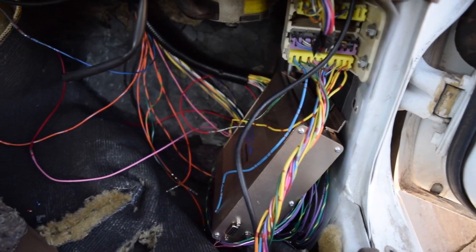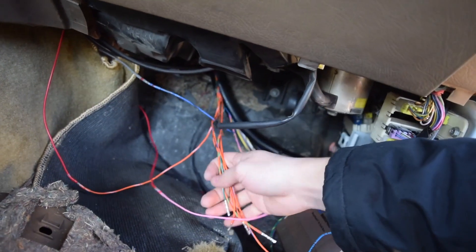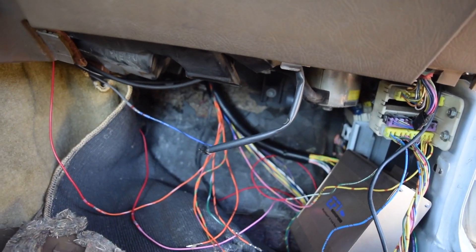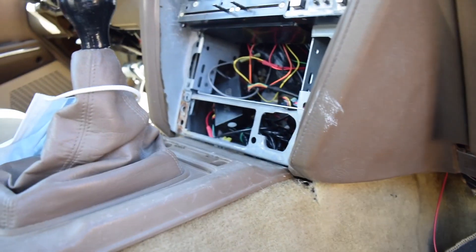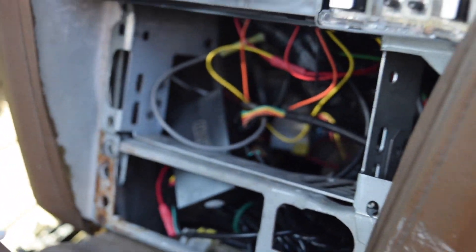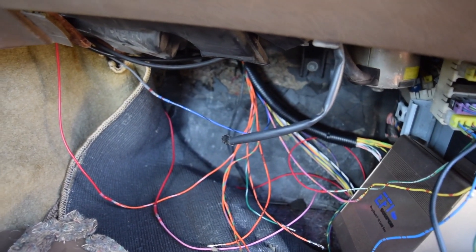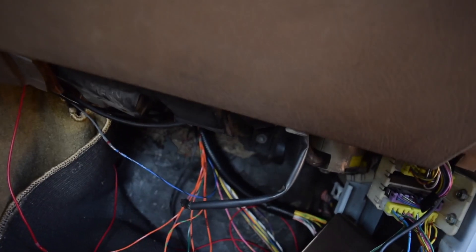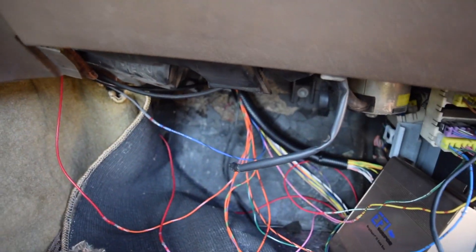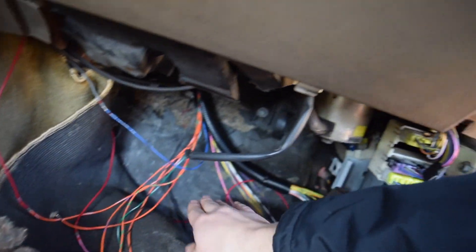Here we are in the interior — it is a wiry mess at the moment, but most of these are the extra wires we have. This pink wire is our O2 sensor going from our wideband. This is the GlowShift box — I wired in a wideband and it has a wideband output, so that goes from there into the ECU. A lot of these are going to be zip-tied up over here. I also have the coolant temperature sensor — an independent one — wired into one of my extra wires.